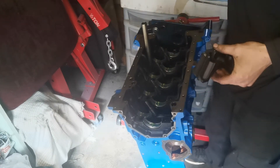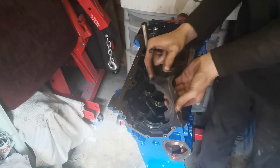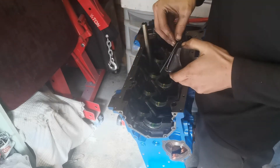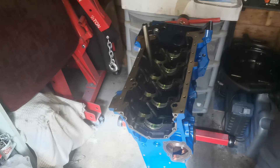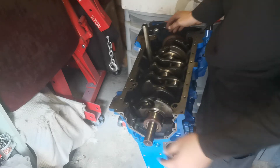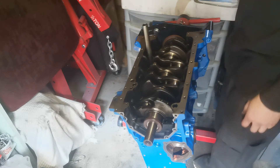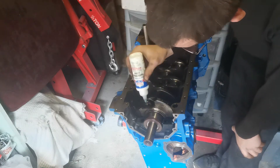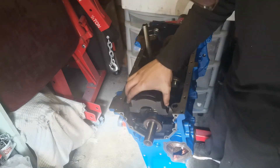I'm literally going to put some assembly lubrication on all these channels. I pull off those little bits on each side, and put brand new ones in — one on that side and one on the other side, pushing them in. Then I rest the crankshaft in to where it goes. It's now in there, all lubricated underneath, and I'll put some more lubrication on the top as well.